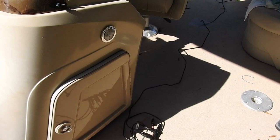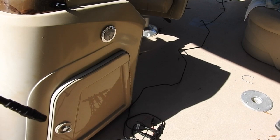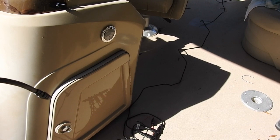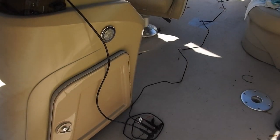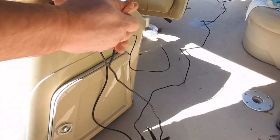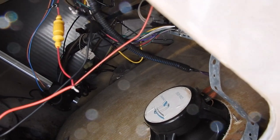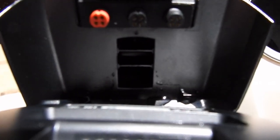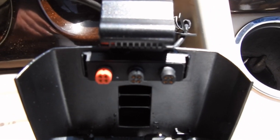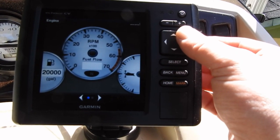So I've got the backbone — I'm just laying it across the deck. This will be the direction and the way I lay the wire, but underneath the boat. My plan is to have the backbone in the console there on the left. This is the wire that's going to go to the Garmin, so we'll just lay that over there. These two here are just getting wired up underneath the console temporarily, just to make sure the unit works. We got the power wires temporarily wired right there, and then we just popped in the NMEA 2000 Garmin adapter — that's the middle plug there.